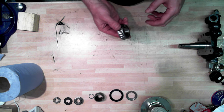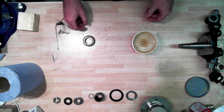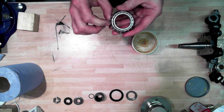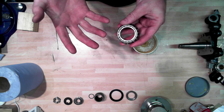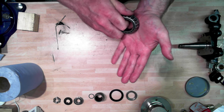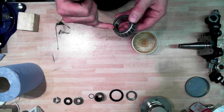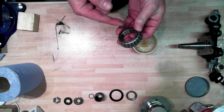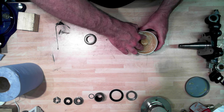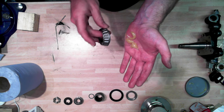What we're going to do now is pack this bearing race with grease. There's quite a good technique for doing this that I've got off the internet. Here's my high performance bearing grease. What you want to do is make sure grease gets all the way through. You want to push it in from one side only in between all of these rollers so that it starts oozing out of the other side, and that's quite tricky. The best method is getting a big lump of grease on your hand and smearing it with the bearing race until you see stuff oozing out of the top. You don't want to try and pack it from both sides because you might leave a void in the middle - it looks like it's full but it's not, and then you've got dry bearings in the middle. This is a messy job and there's no getting away from it.